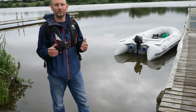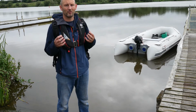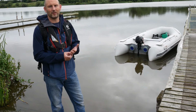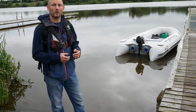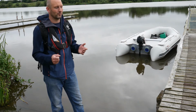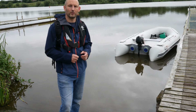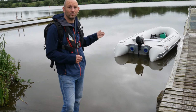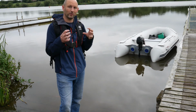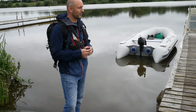The second thing, and I've noticed with this, and again, a big thank you to you guys out there in the YouTube community. You've given me so many suggestions, but the petrol tank, I didn't believe it. I had a comment on here, check your petrol tank, there's loads of bits. Well, he was right. There were loads of bits in the bottom of the petrol tank, so I discarded all that old fuel. I flushed it out with a hose pipe, let it dry over the 2 days, and then I just put the fresh fuel in. There is no fuel filter on these small motors, and the idle jets on the carb are built into the body of the carb, so there's no just taking it out or anything like that. So it really is key.